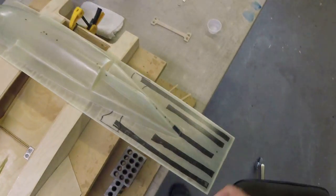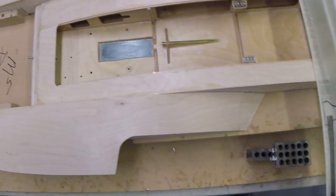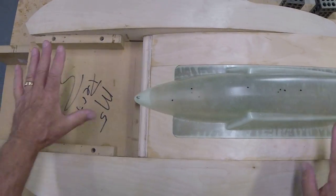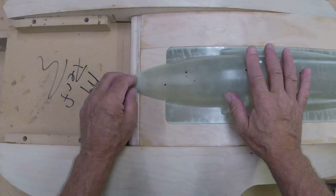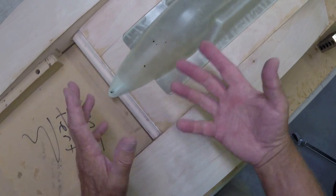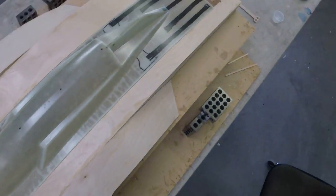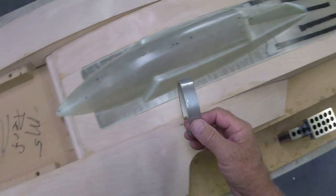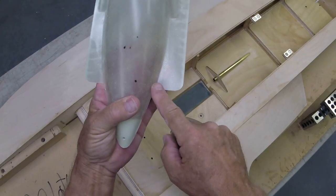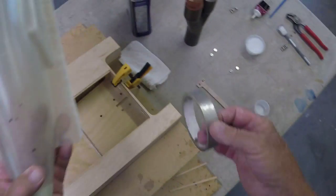Because I'm racing, I'm going to do whatever I have to do to make sure that magnet doesn't grab anything, and that I don't wash out the motor. If I have to go through someone's rooster tail, from the general violence, water will come up underneath here and this will not fit this well later in life. Things just move. Fiberglass moves, wood moves. I tape it. I use radio box tape before every heat while this is sitting ready to go on the boat after I start it. I place radio box tape here and here, just this forward section, hanging off the edge.